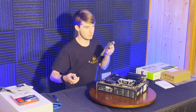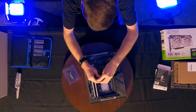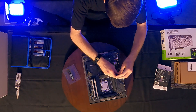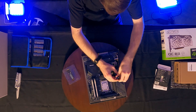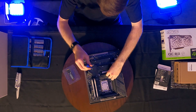Now let's get straight into the tutorial. We're first going to start off by unboxing our SSD, and then you want to get out your motherboard manual and locate the NVMe SSD slots on your motherboard. Then, yet again referring to your motherboard manual, go ahead and find which slot you need to install the M.2 SSD in. These slots should have some kind of cover that you have to unscrew, so go ahead and unscrew and take off that cover.